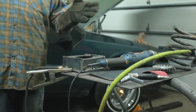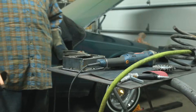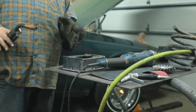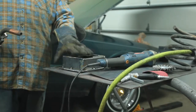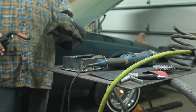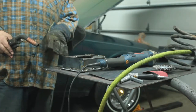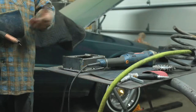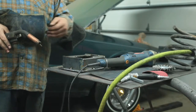You're probably wondering why I didn't just use C-channel. The underside of this Lincoln is kind of an odd shape, so C-channel didn't look like it was going to fit under there. Plus I wanted to make some little boxes to help hold the spring. Because of where I have to weld this plate in is actually lower than where the factory spring perches were by about this much, so I can still lay as low as I was before and have some strength.